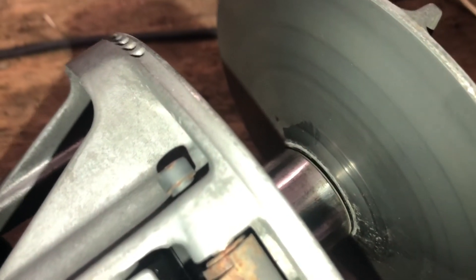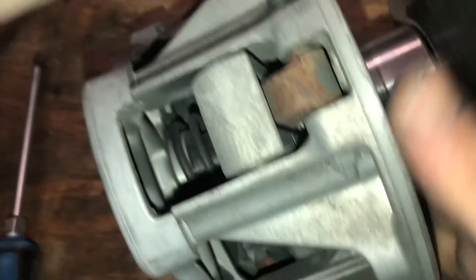Now it's time to inspect the primary clutch. For a full inspection, Rocky Mountain ATV and Motorcycle has a very good video on clutch inspection — I'll provide a link in the description. This clutch has quite a bit of dust and debris still in it. It does, however, have a groove worn on the clutch face, which usually requires a clutch replacement. It won't properly release or grab the belt, so we're going to get approval from the customer to probably replace this clutch. Normally it's this bearing — where the belt sits while the clutch is spinning and you're at a stop — that's the culprit. In neutral it will allow the belt to sit still while the clutch spins. The bearing on this one is actually still good, which gives even more concern about the groove in the clutch face.